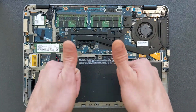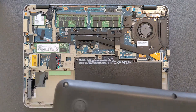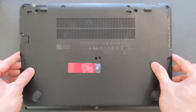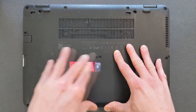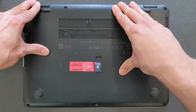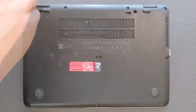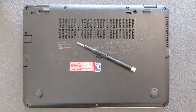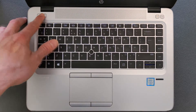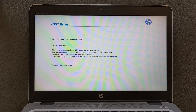That's the second one in — RAM upgrading is done. All that's left to do now is put your back panel back and put the screws back in. You kind of have to press the back panel in; you can hear the little clips. Then put the screws back. Once you power on your laptop, you're going to get a message about a memory size change. All you have to do is press the Enter button — just press Enter and that's it.